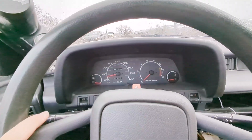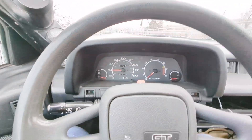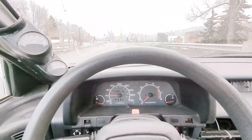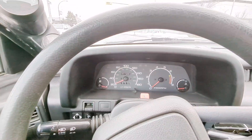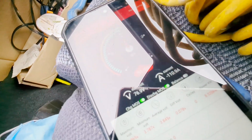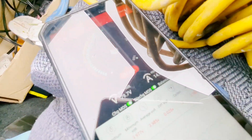We need to get up to speed — that's 40 kilometers an hour in second, then fourth gear. We are going 50 kilometers an hour; I don't think I've ever gone this fast in this car. This is the coolest thing — it is working. I've got my live amp meter and my digital amp meter, and if I let off, it starts charging — I've got regen!